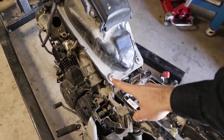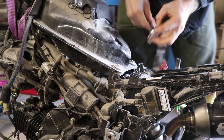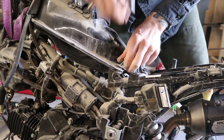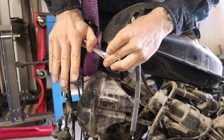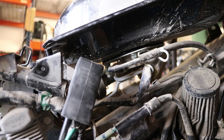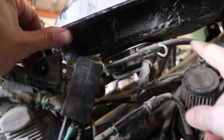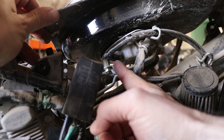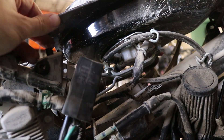Now I'm going to take off the fuel tank. There's a couple bolts right there, and then we've got this bolt right here. Over on this side we've got the actual fuel line, which is this guy right here - this comes in and plugs in right there. We've got to disconnect that plug, and then we've also got an electrical connection right here as well.